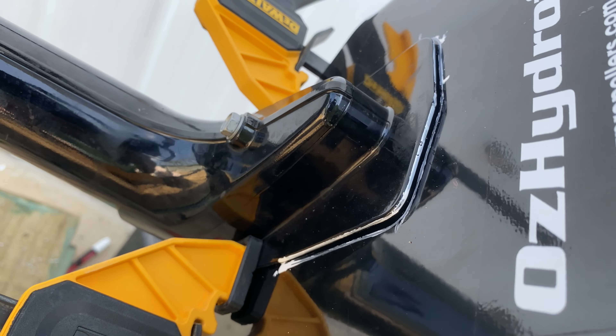I'm a bit worried about this hole here and this hole here — there might not be enough meat on this side. We're just going to do it anyway. I'm drilling from those holes we made before, just banging it in from behind. She's a bit off. All right, we have the holes drilled. Now I'm going to attempt to clean off all the poop I've put on there — I've got some isopropyl alcohol and a magic eraser and it is coming off thankfully. Now we're going to use some of this to seal it. I've popped these in and I've put some Teff Gel which just stops any corrosion from dissimilar metals. I'll tighten it down and we'll see how it looks.